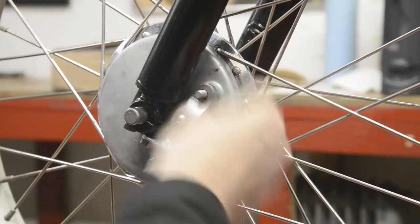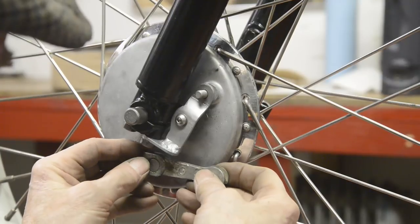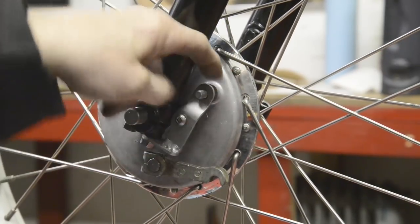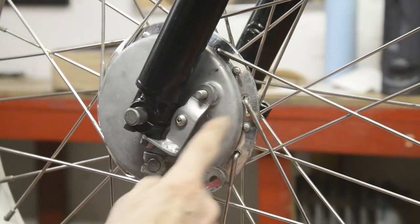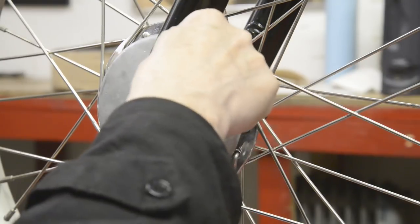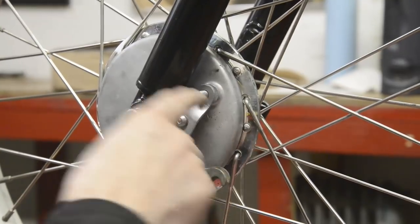That's there. So that's all rigid. Now then, the next thing we need is an anchor point for the cable. I've left a gap behind here, which is enough for another piece of this eighth. I'm going to make it come out here like that and actually come to here, so it'll have that little bend in it, and that should be quite strong enough. And then we'll turn up a piece like a little thimble for the adjuster to go into. So let me go and get some eighth, measure that, and we'll get this bit made.